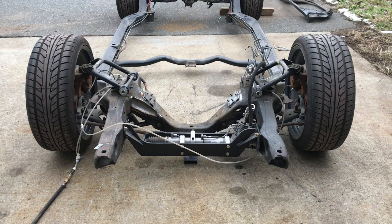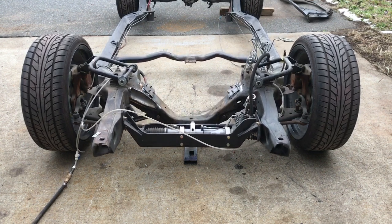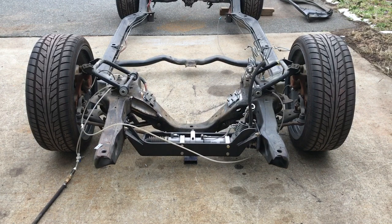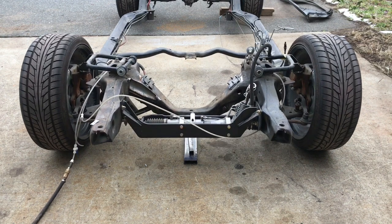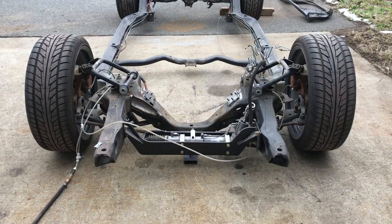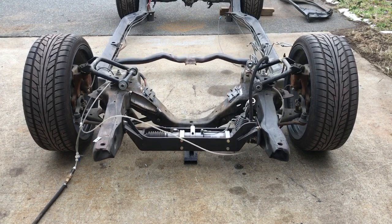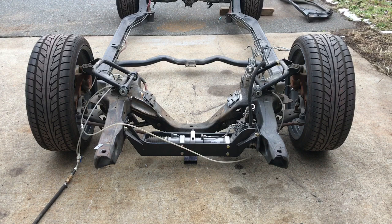Now we're outside in the shop and we'll see exactly what this suspension is doing. I'm going to air it up and you'll see the tires and wheels go out — they'll toe out. And when I take the air off, they're going to toe in. That's caused by the tie rod ends. You can see once they're level or almost more level to the ground that it pushes the tire or wheel out. So you can see when they go down the tie rod end has a bad angle — it doesn't have the right angle. Let's work on solving that problem.